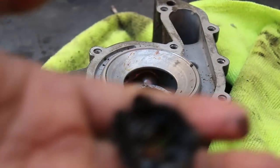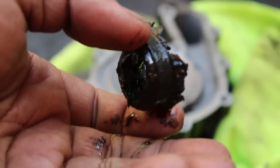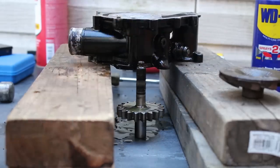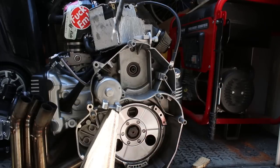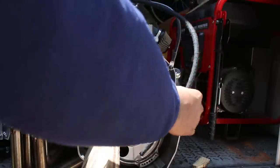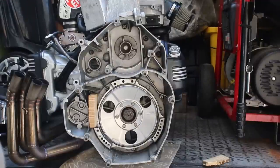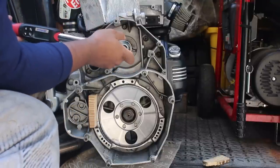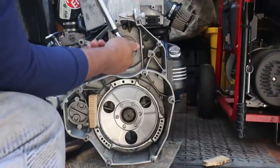If it's the old-style impeller, a cheaper and faster route compared to rebuilding the pump fully would be to source a good used K1200 pump and slap it on, as it has the improved design and seals from the start. I would ask if there's any starter sprag clutch issues, because the K100 has this rare but present issue where the starter clutch will not engage the crankshaft, causing the starter to spin in place without turning the engine over. You can generally fix this without digging too far — rock the bike in gear and try different remedies. I solved it by running better-suited oil, but if that doesn't work you'll have to remove the bell housing.